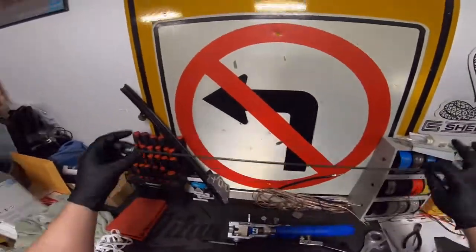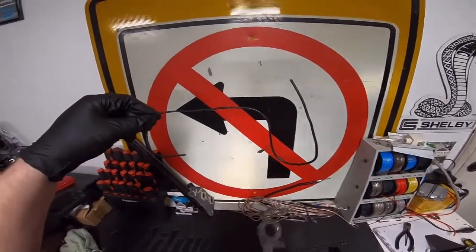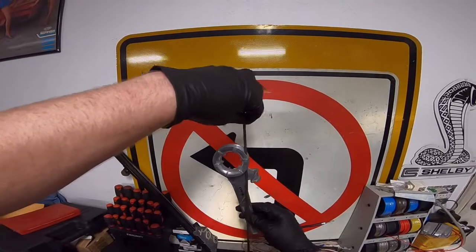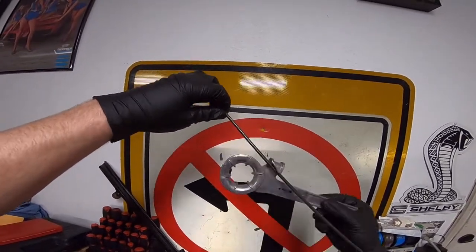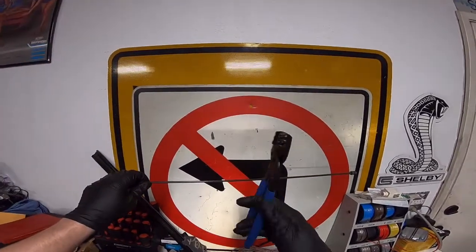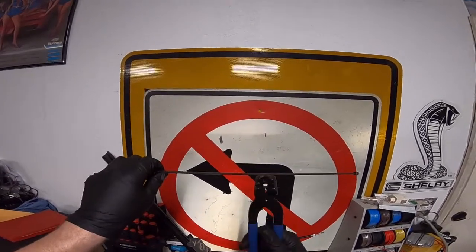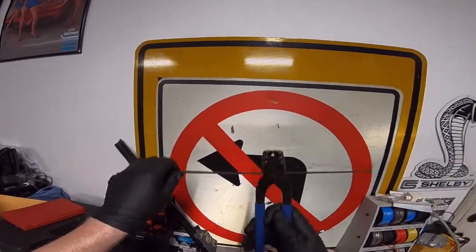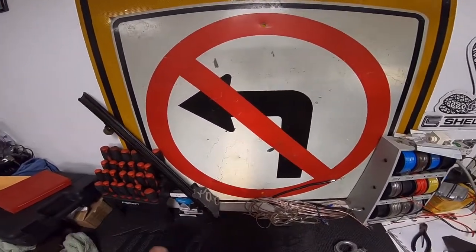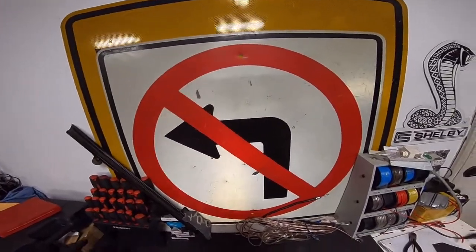Now that you've got your custom line made, this is the shape I need. There are a couple of tools you can use to bend your brake line — you've got this spring bender where you stick the line in and bend it. You don't want to kink it, that's why you use this. Or you can use these tube bending pliers to shape it — they're rounded here and there'll be a link in the description for both tools. You just want to bend it to match the shape you need, and that's pretty much how you make your brake lines.